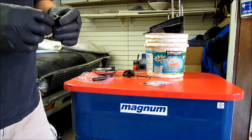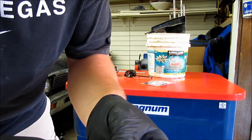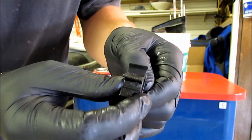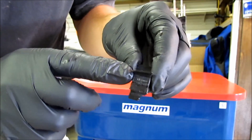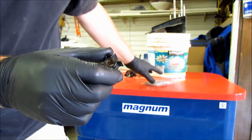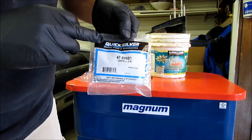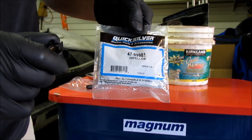Just had a vane break off the little impeller here. If you look closely there's a part number on it — right there. I'm not sure if it's upside down or not but that's how you find out which one to get. There are different shaft diameters, so I just took this to the shop and got this new Quicksilver replacement one. Go ahead and put that in.